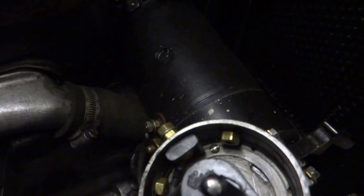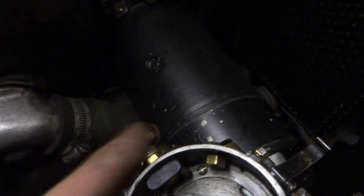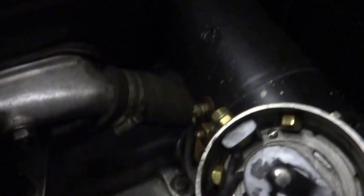That is then completely original from the outside — you can't see the red wire, and the black wire is connected up where the wire used to go to the condenser. On the condenser side, because you want to leave the condenser in place for originality, I made a little plate like the original out of a piece of polythene from a 5-litre oil can, covered it with shrink wrap so it looks just like the original, and popped it on. It doesn't do anything because it's just polythene, but it makes it look like the original for completeness.